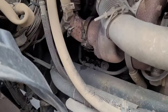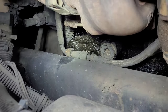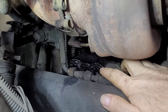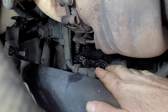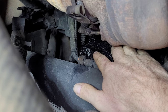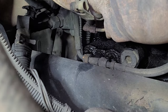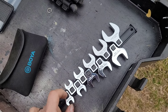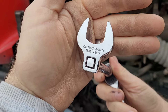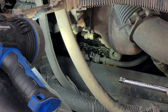Today we're going to be replacing - hopefully you can see that little T right there that comes out of the oil filter housing. Right below that yellow piece is the oil filter. We'll be replacing the O-ring. That turbo is hot. There's the O-ring that goes right there, one over here, and one right here where the oil filter housing is. I think that's where the leak's coming from. I bought these little wrenches at Lowe's that go onto a ratchet - maybe it'll make it easier to get in there. And here are my O-rings. I already know this is a 13/16th - let's try putting it on here first.